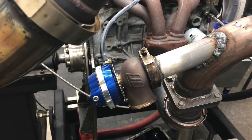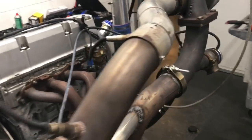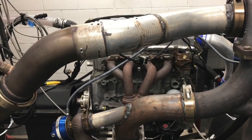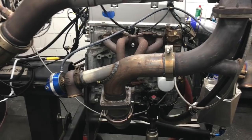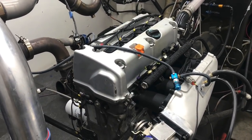We're able to go all the way up to 15 or 16 pounds, and this thing already made 600 horsepower. That's the reason I did this. I know everyone's going to say 'that'll never fit in a car' or 'it's not the right exhaust manifold' or 'you'd make a lot more power with something else.' But the reality is I wanted to show you that even with all of the wrong things — stock plugs, wrong heat range, way too hot, stock exhaust manifold — if you get all of that exhaust to the turbo and all that boost through an intercooler into the motor, a turbo K-series makes a lot of power, even when you do everything wrong.